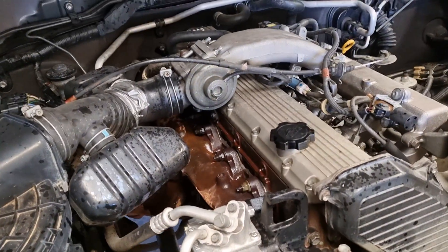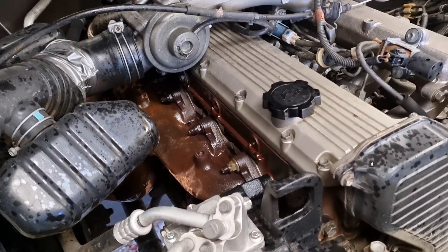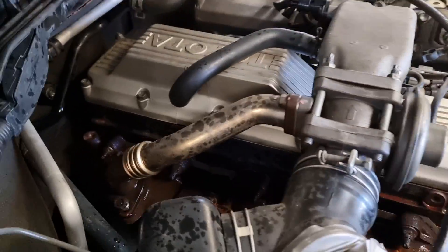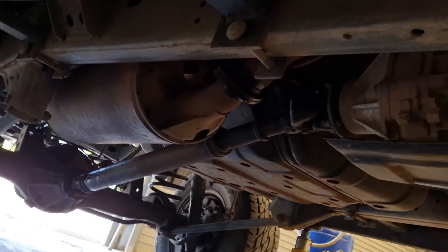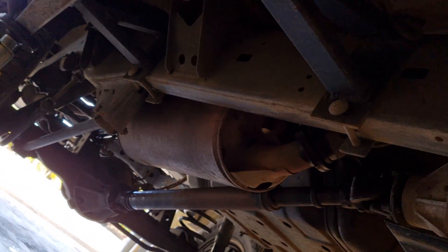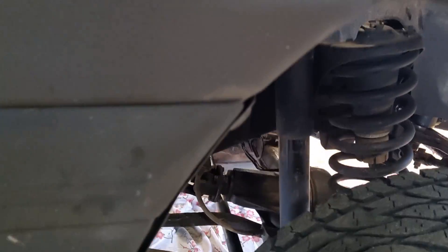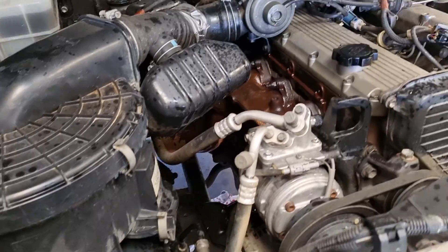In preparation for removing the exhaust manifold and other components, it would be good to use your favourite penetrating lubricant on all the bolts and let it marinate for a couple of days — all the exhaust manifold, the exhaust flange, your front pipe flange as well, and depending on what parts you're keeping, the whole lot. If I can remove the exhaust without a grinder, I'll ramp it up on the dyno for a power comparison between standard exhaust and a 3 inch exhaust.